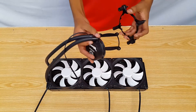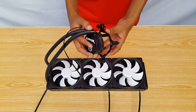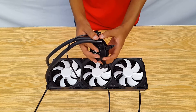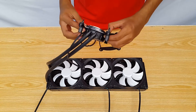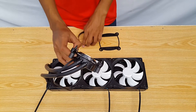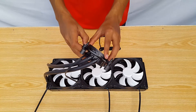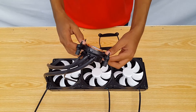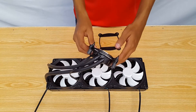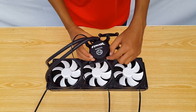Now take the pump — you'll notice the locking mechanism similarity, they'll lock themselves in these small holes. Just hold the pump like this, attach the upper bracket, rotate it a little and pull it outwards and they'll be locked. But they still need the lower bracket for a complete lock, so take this ring bracket and insert it in the gap like this between the locks and push the edges. Once you see the edges of the ring over the upper bracket you'll know that they're locked.